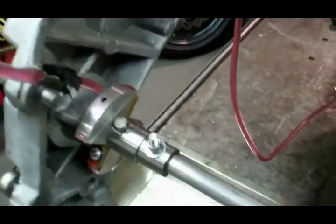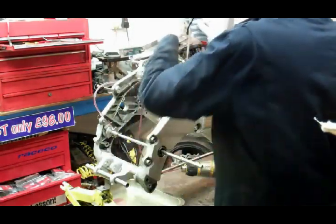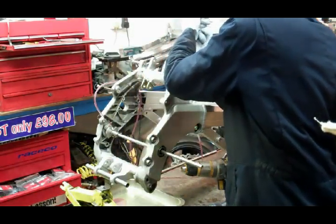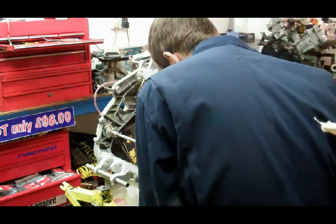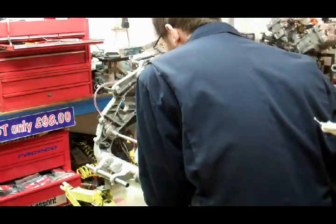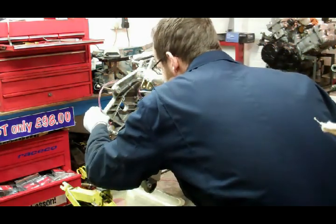I'm just drilling it through so I can screw it on. Here it is fully assembled in the frame — there's the bit where I'm going to put the drill on. Here's the cutting tool in the frame; the red tube is going to carry some cutting fluid. That red plastic bush is quite important to keep it turning straight. All we do now is turn the coolant on — just a simple gravity feed tank — connect on my drill and basically force it through.